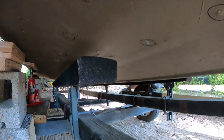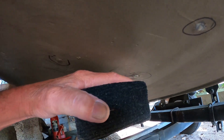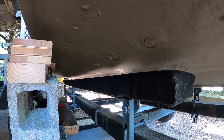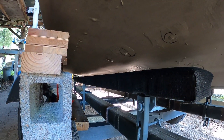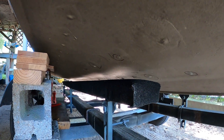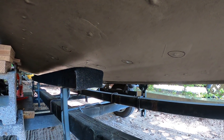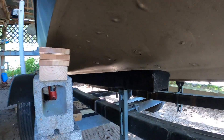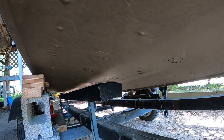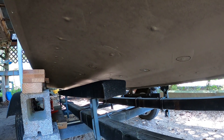I'm gonna go in here with my angle grinder and clean all this off — that's one of the major culprits right there if you can see it. I'll clean everything off good with a flap disc. I've got some long pieces of aluminum; I couldn't find what I wanted in town so I'm just gonna use what I've got until I run out. I also have some thinner stainless steel. I know you're not supposed to mix stainless and aluminum, but at this point I don't care — this boat has got to float.